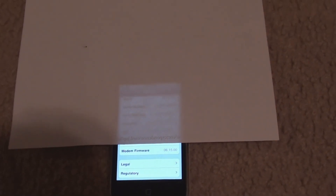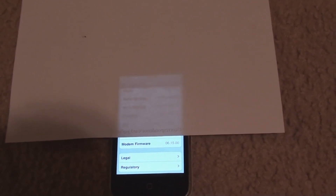Today I'll be showing you how to update your iPhone 3G or 3GS on an iPad's 6.15 baseband. Because if you update it through iTunes the traditional way, you'll get an error because of the iPad baseband change.